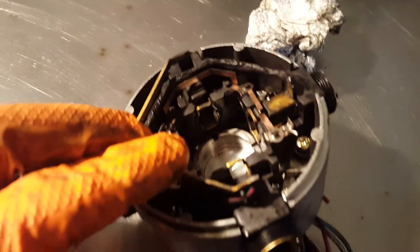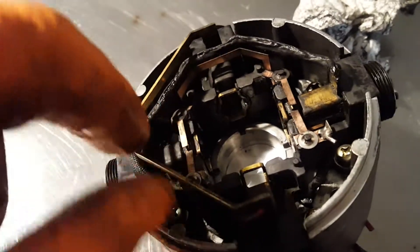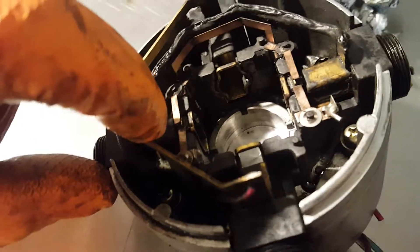The other two — the blue and the white wire — connect to either side of these little bridges, little switches that get pushed up by the brushes. And it looks like when they wear out, they'll run into that little notch. These are insulated from the brush, so it's not going to get any power off of the brush — it's just, if it hits that notch, it looks like it's going to disconnect this switch.